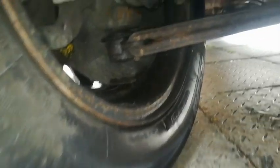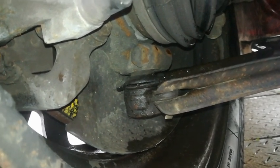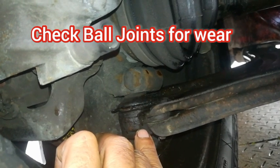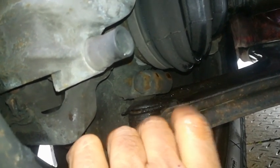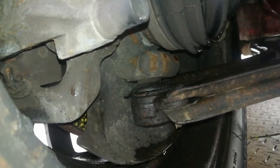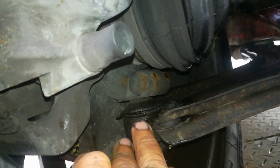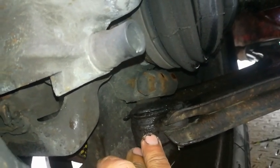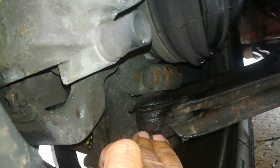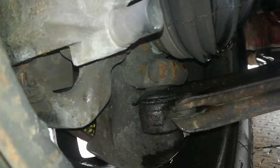I'm now under the car at the front wheel on the inside. The next thing to check for vibration and shaking is your ball joint — the part that sits between the control arm and the hub. You need to check it for damage. In my case here you can see there's damage — I was searching for vibration on my car over the weekend and found that this ball joint has a bit of damage; the boot has perished. I'm going to replace this ball joint soon, but a damaged ball joint is also a culprit for vibration and shaking.